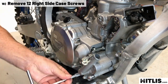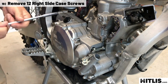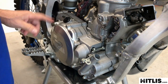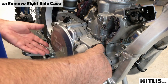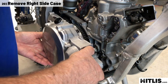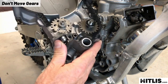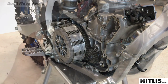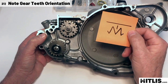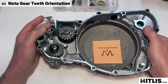Next, remove the 12 screws that hold the right side case on — loosen and pull all 12 of those screws. Then hold down on the linkage and grab the case, wiggle it off of the alignment dowels, and slide it right off the kick shaft. Don't touch the gears at this point. Keep your thumb down and go over to a bench. Grab a pen and a piece of scrap paper and mark the orientation of the gear in relationship with that flat spot on the case.